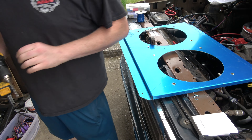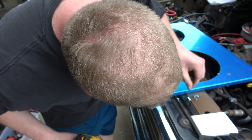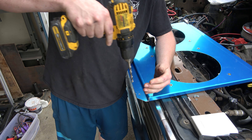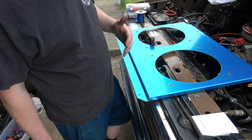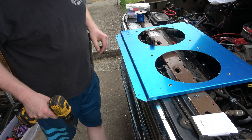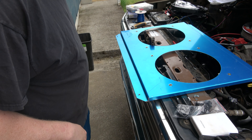My friend Todd will probably comment on his experience with those — they kind of left him with a broken radiator. This engine is brand new — it's got a new harmonic balancer, brand new flywheel, the correct balance, and the crankshaft and rods have all been balanced together, so it's not going to rattle too much. But those zip-tie things act as a saw when you get vibrations, especially with a diesel like a Cummins with solid motor mounts. I'm using another drill bit as a deburr tool. Kind of glad I'm done working on stuff underneath for now.